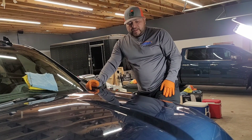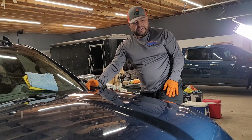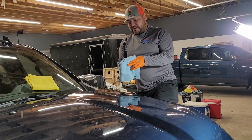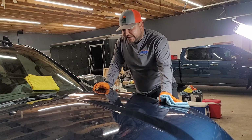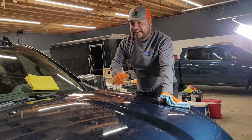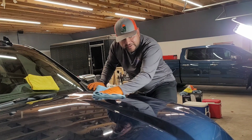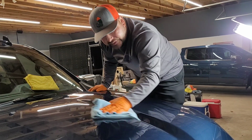So two questions that I get asked a lot about the Max Shine coating is, one, how long do you let your coating sit? And really, this graphene coating, I have really enjoyed it just because of coming from DPC, right, where you apply the coating and you have to take it off pretty quick. This one really lets you, as an installer, not rush the process. So this has already flashed, and the buff off, literally, is very smooth, very easy to do.